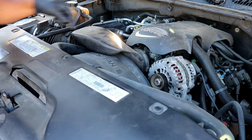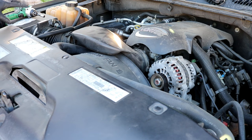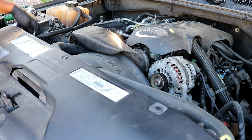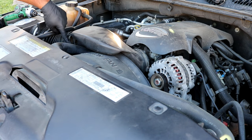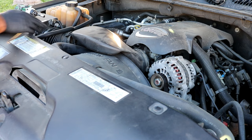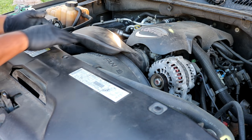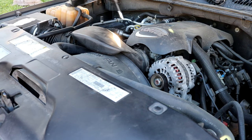First thing you want to do is remove the air intake tube. It's held on by two 8 millimeter screws holding the clamps — one right here and one on the air box over there. You don't need to take off the mass air flow sensor or disconnect any of that; you can just disconnect right here at this clamp and at the other clamp. Additionally, there are some coolant hoses attached to clips — there's a clip holding the hose. When you take this out, you can push the clamp out with a screwdriver; it's just pressed into the plastic.